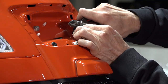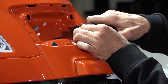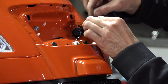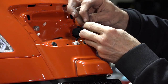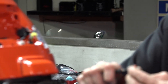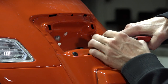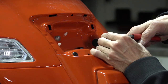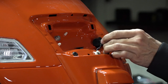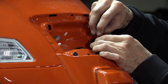Pull that little rubber grommet out to give yourself a little more room to work with, then put it back in place. There are going to be two crimps needed here. Put the female bullet on one end — it may be a little long, so you may want to cut back some insulation since there's not much wire to work with. Crimp that on. You'll need a crimper — this is a nice set from Snap-on, but less expensive ones are available. Then put the male bullet on the other end and crimp that.